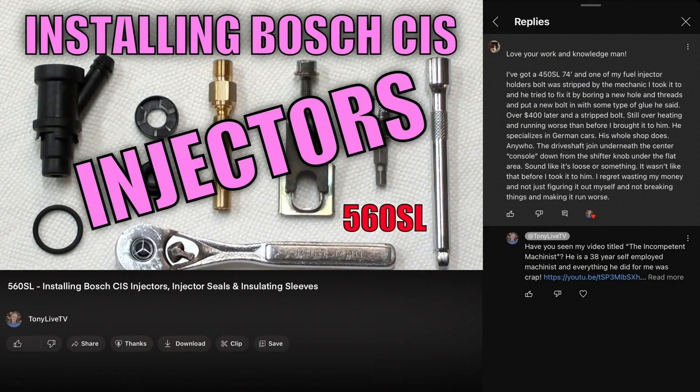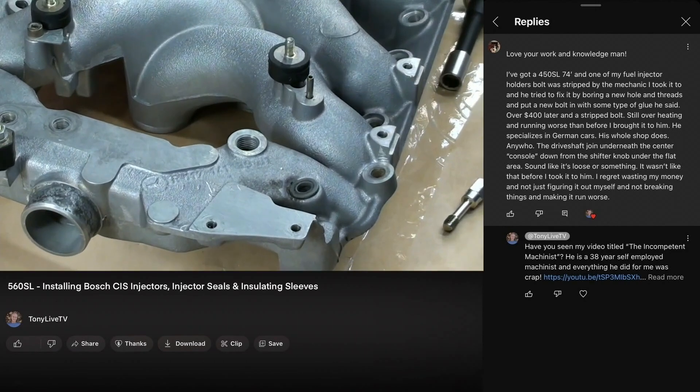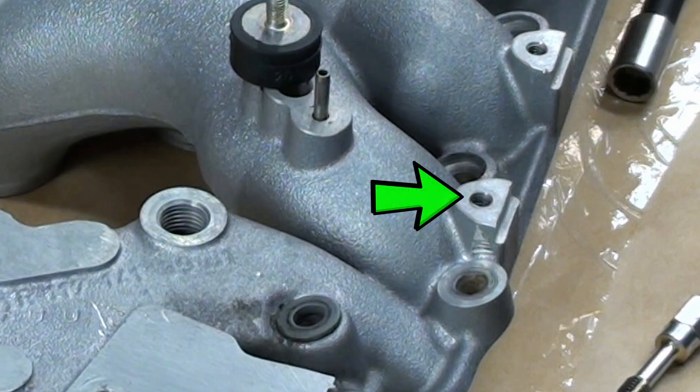If you're a subscriber, you know I installed the injectors, and those injectors are held down with little clips and little short bolts. Unfortunately, the very first injector that I installed in that video, the bolt hole stripped. I pulled up an old video of when I took it out of the vehicle, and if you look, that number five clip area right there is shiny, and there's hardly any threads right there. That's why — these things just pulled right on out. It was already stripped.